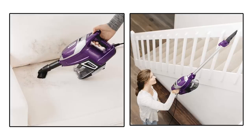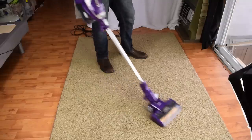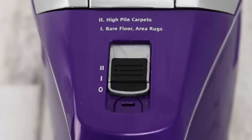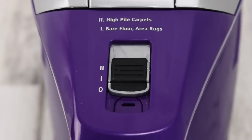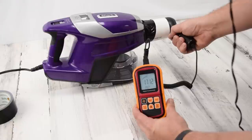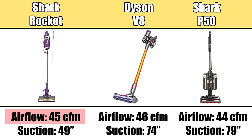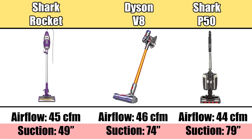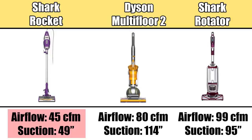It was fairly versatile. You can use it as a handheld with the included upholstery tool or crevice tool. It's very adept at getting into hard-to-reach places with its slim design and very smooth swivel. It has two power options: one for hard floors and one where it spins the brush faster for carpets and thick rugs, though the actual power output doesn't change when you change modes. We measured the airflow at both the base and at the cleaner head, and found that it had 45 CFM and 40 CFM respectively, and its suction was measured at about 49 inches of water lift. Those airflow numbers are about on par with a high-end cordless vacuum like the Dyson V8 or the Shark Ion P50, though its suction is a bit lower than average. As a corded vacuum, compared to its corded counterparts, it would be considered below average.